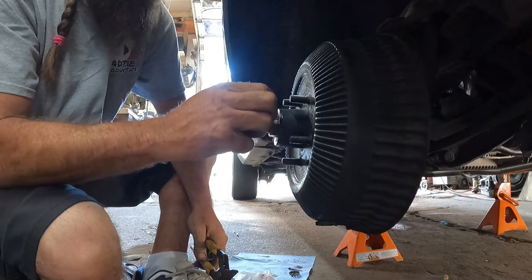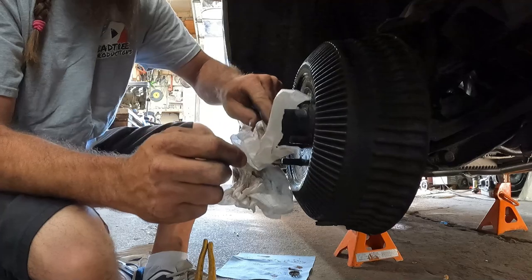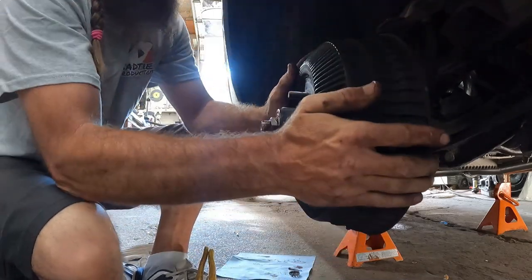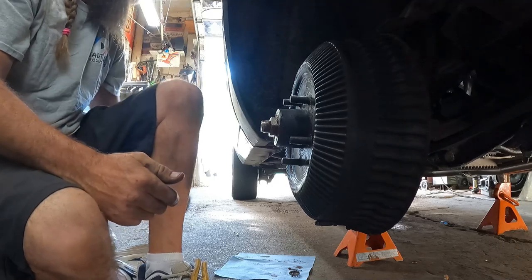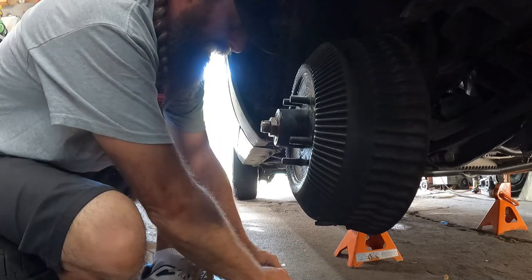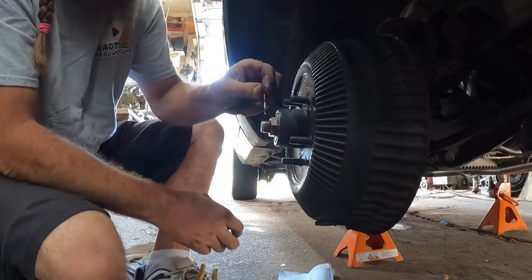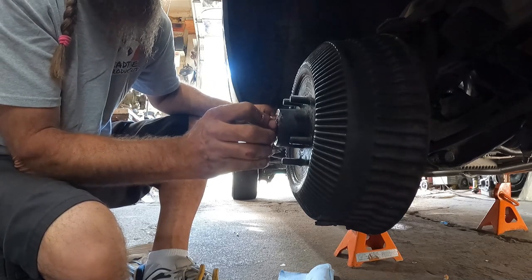I've always set wheel bearings. I guess I don't even know how to explain how I do it. I tighten them down, I turn them, and then I back them off a little, then I turn them. And you want them to be tight. I mean, they will loosen. I guess it's a feel the way I do it. I've done a lot of boat trailers, and those have got to be the most abused bearings in the world, and I've never had a problem.